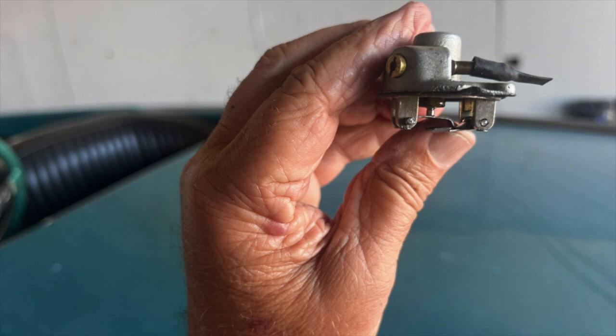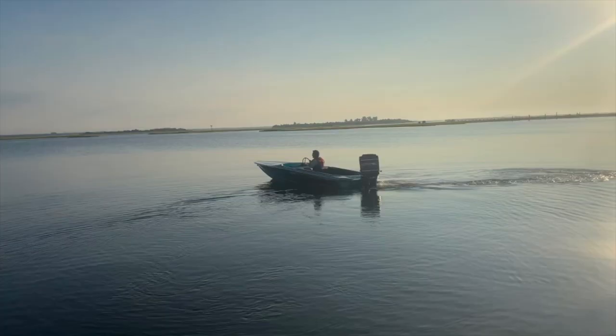So I installed the new old stock parts, flipped it over, and was lucky enough to see that the level was correct. This solved the leaking fuel issue. We also sealed off the bypass tube with new shrink material.